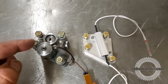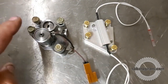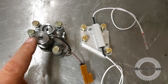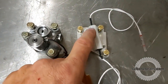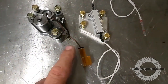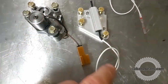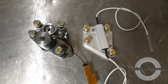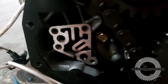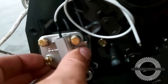The original Subaru transmission has this AWD duty solenoid. When power comes through to the solenoid it lets oil pressure go through the AWD clutch. As we're not using it anymore, we have a block-off plate. Instead of connecting the solenoid, which is too deep for our casing, we have a resistor which provides the same resistance to the computer as the solenoid does, with low-temperature solder connectors. You can simply cut off the original connectors, solder them onto the resistor, plug it all in, and you won't get any errors. We've put the original aluminium plate back on and then install the block-off plate over the top.